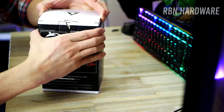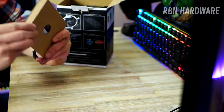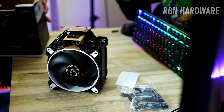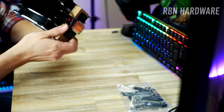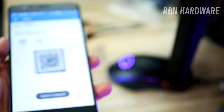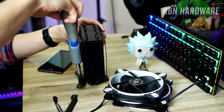Alright, it's finally time to install the new CPU cooler. It's easy to tell that Arctic has been working on improving their CPU coolers lately. The Freezer 34 Duo comes with two new fans from Arctic's Bionic X P-Series, which are specifically made for high static pressure operations like pushing air through heat sinks. The installation is simple, but there are no instructions in the box — instead you scan the QR code and get redirected to a site where you can download the manual, which is made up of moving pictures to help you understand things better.